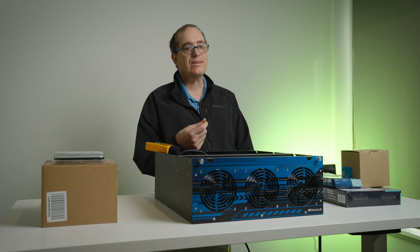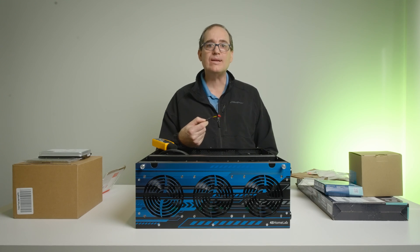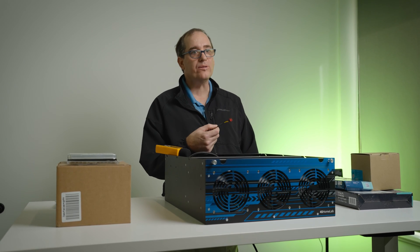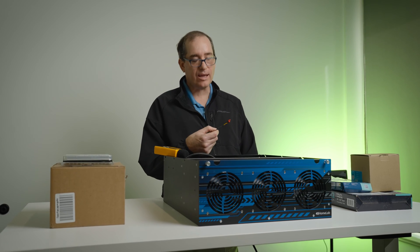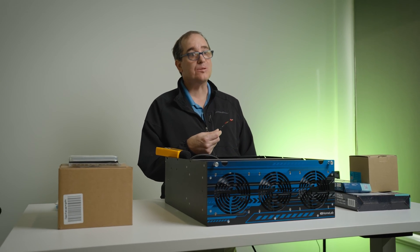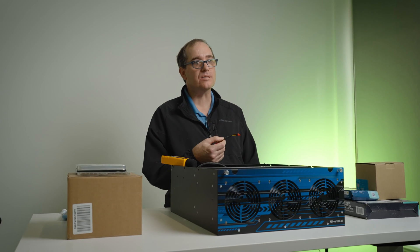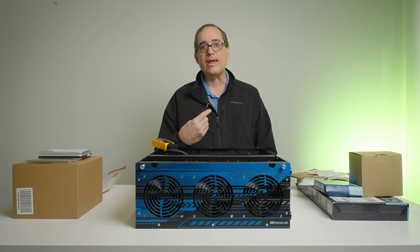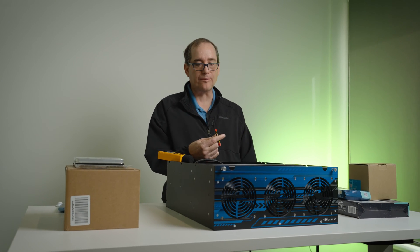These little guys are fan decelerator cables — 47 ohms — and they should slow the fans down by maybe 50 to 55%. Is that going to be too much? Too little? I don't know. We're going to throw them in, give them a whirl, and see how the sound changes. Then we'll take a look at temperatures once we're running in production. If all goes well, I think this might be the solution — it's the easiest one, they just plug straight inline. These are three-pin; I'll leave a link in the description below.